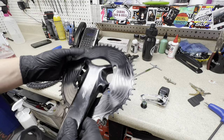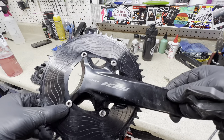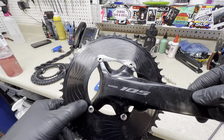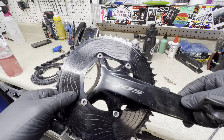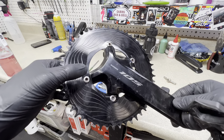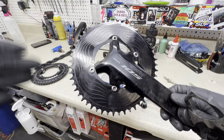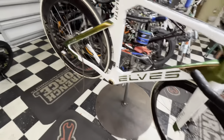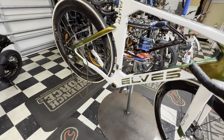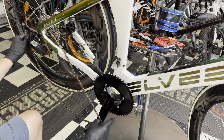Putting the chainring back on — chainring bolts are all snugged up, so we can throw it back on the bike. Quick tip: if you guys are having a creaky or ticking noise you can't figure out, sometimes check your chainring bolts and crank. A lot of times I fix that on a bike and it takes away a ticking noise and people are surprised they were loose. I'll do a video walking through the steps to diagnose a creaking noise on a bike, because this carbon fiber bike echoes and it could be coming from anywhere.